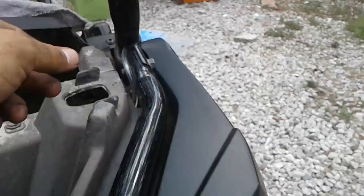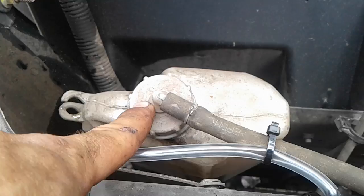In the front, we ran vent lines up the other hoses. This is the front diff — runs up here. Don't worry about drilling a little hole in your roll cage; it's more than strong enough — it's a Honda. This is the vent line for the fan, running all the way up there. The radiator cap on this breathes through the cap, so if you want to snorkel that you'd have to put some O-rings on it and a little barb fitting. We didn't mess with that because getting a little water in the coolant is no big deal.